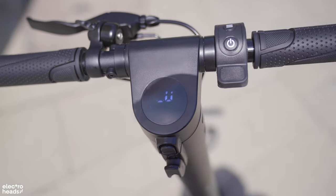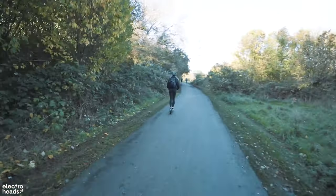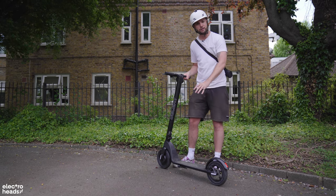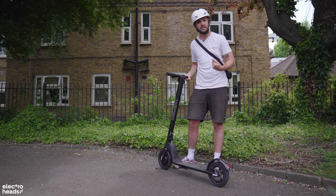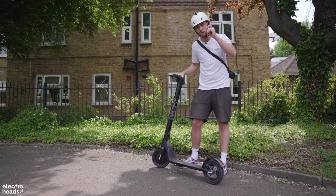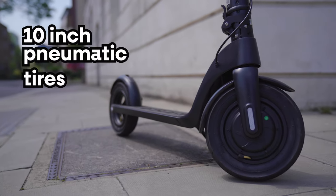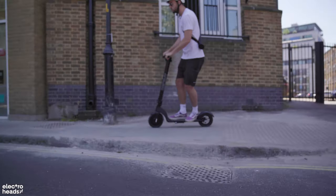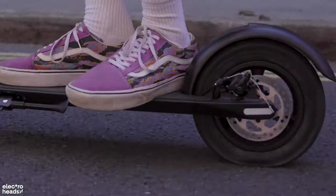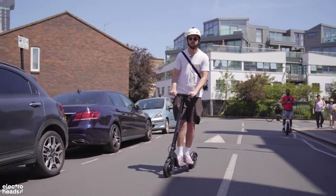The area where this thing really blows me away for its price point is the ride comfort. Most budget e-scooters like the Xiaomi M365 use airless tires because they don't get punctures and they're lower maintenance. But the problem with those is every bump, every crack comes up through the deck, through your feet, up your legs, into your spine. You've got to keep your knees super soft and look out for any hazards because any crack in the road could be your last. But with the Decent, they've opted for big, squashy 10-inch pneumatic tires, and they are an absolute game changer. They almost work as suspension — for the money, the ride is like a Rolls-Royce compared to other cheapo scooters.